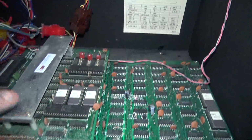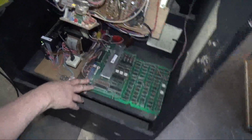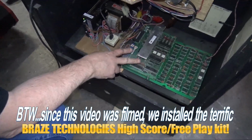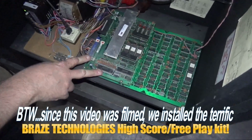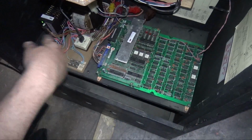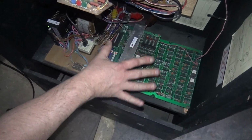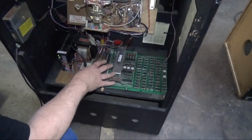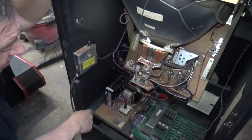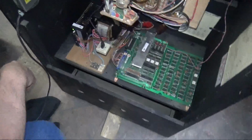There we are. Does it have a free play setting? Does not have a free play setting. Well, you should know there are 2 different board systems for this. This is the standard board system with the Konami pinout. But did you know that they have some Froggers with the Galaxian logic board that was converted? It was actually factory. The Namco factory made the Galaxian and Mooncresta. It's very similar to that. Mooncresta Frogger will also run on that too. And of course, it'll have a different pinout too. So you have to just check and see what's going on.